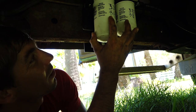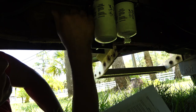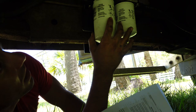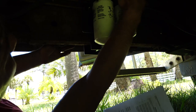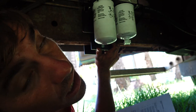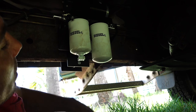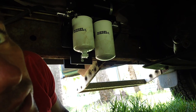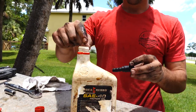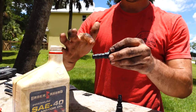I accidentally put this thing on the wrong way — this side needs to go to the engine for return and this side is supposed to be supplied from the tank. So I'm going to swap the whole thing around and do a mirror image on the bracket. Now it's much better. We'll fill the fuel filters up with diesel before we attempt to prime the system, just to get them sealed up so nothing gets dirty or any bugs in there. These quick-connect fittings are great. One's for the supply from the tank to the whole system and the other is the return from the fuel filter pump assembly back to the tank.